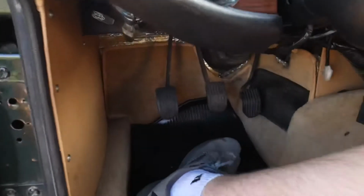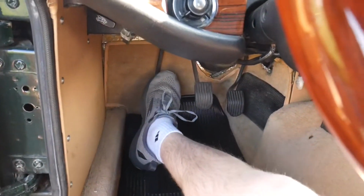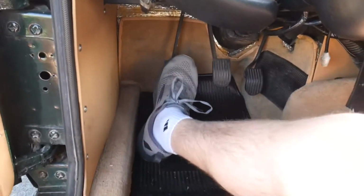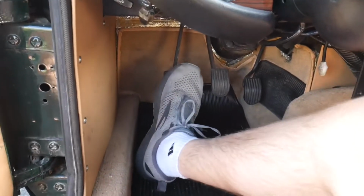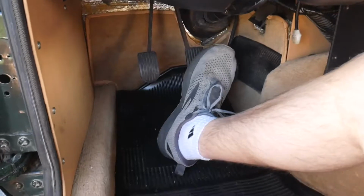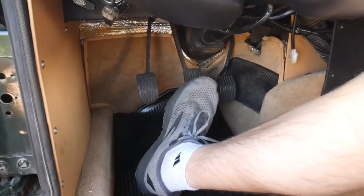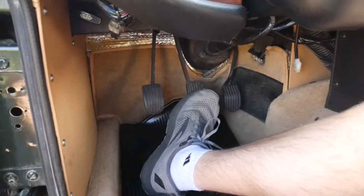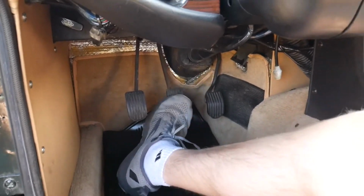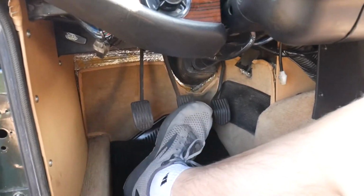So guys, literally like 30-45 minutes later of literally just pumping up the pedal and checking the fluid, I now have a clutch pedal there. There is pressure and it feels pretty dang good. It doesn't seem to be drinking down any more fluid, so this might be it. And the brakes, they do build up relatively quick. Like right now they just faded away, but if I just go like this, then they're back. So I'm not really sure. That might just be because it's not running, and it does have a brake booster, so I'll just have to see about the brakes once it is running.